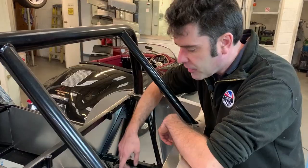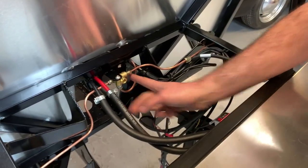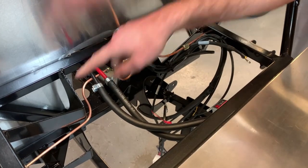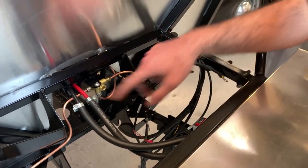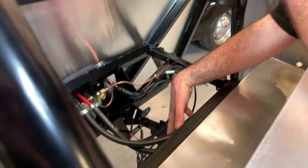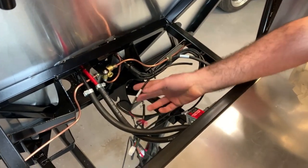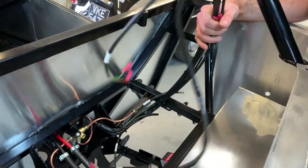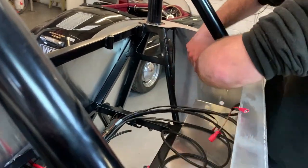And then go into the back of the car. At the back of the car, you've got your brake pipe coming through, looping down so you've got room for your handbrake cable — so you're not going to get the brake pipe anywhere near the handbrake cable. That comes up into your four-way T-piece, and you then have your left and right tails off that go to your rear wheels, and the brake pressure switch goes into the middle. The pipes come through for the fuel lines — the rubber hose connects on to the fuel system, which we've covered in the previous video. Your wiring loom comes through, goes round to the right-hand side. You've got your tail off that goes to your brake light, and then the rear section of the loom — so all your rear lights, your fuel tank sender and your fuel pumps — goes round behind the fuel tank.